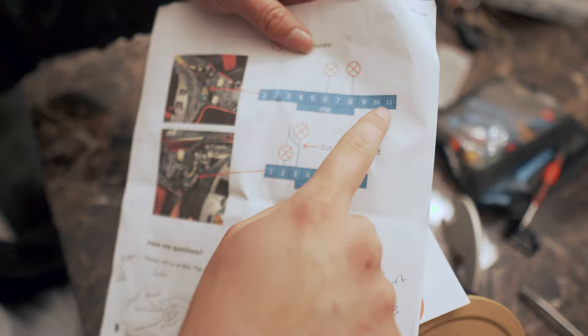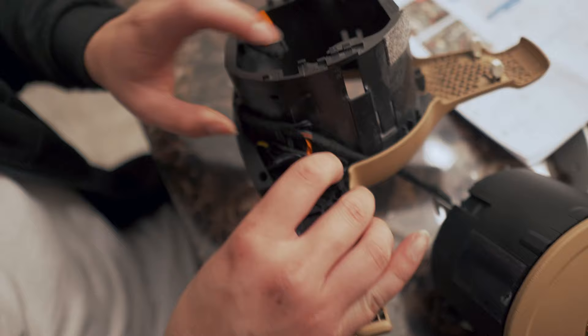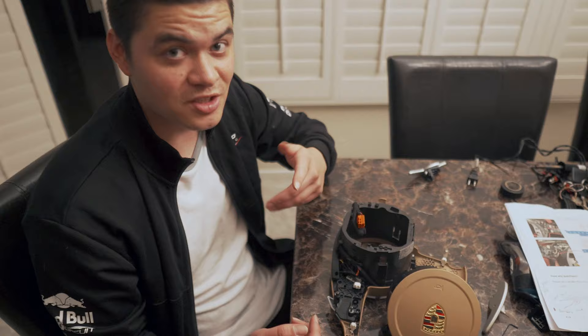These are our instructions. It says we need a clip with 11 wires in it and one clip with eight wires — that's what we need to get to. As you can see, we have no clip with 11 wires; we have one clip with eight and two clips with fours. This is not the same circuit. I tried to do the same thing using a different clip assuming maybe it still works the same — it doesn't. It disconnects your horn.